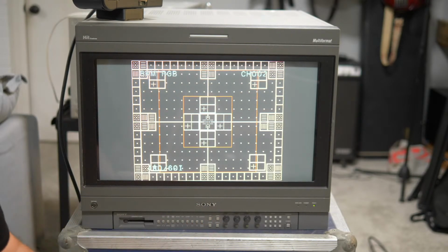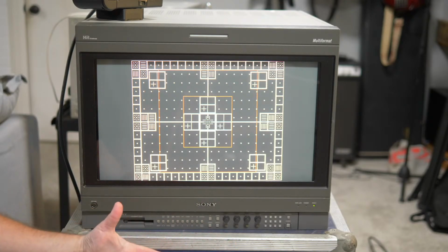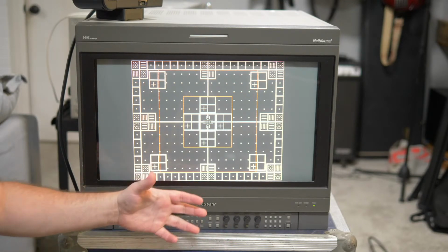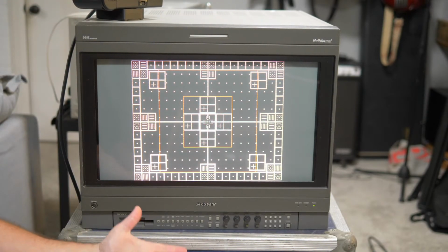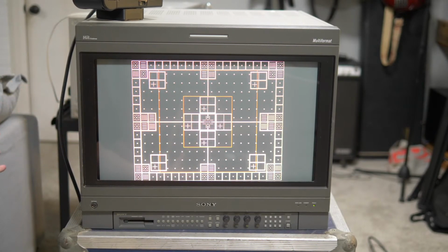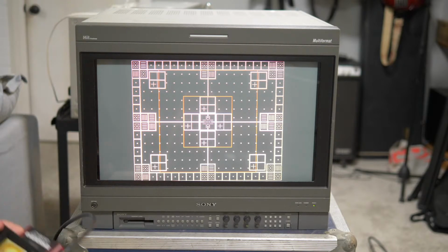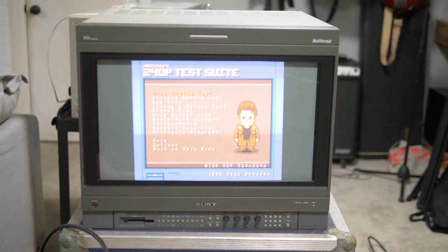So let's just say hypothetically that the monitor was in bad condition. It's not, it's in great condition, but let's just say hypothetically it was in bad condition and the capacitors are the reason that that shifted up. So when I replace the capacitors, I just have to shift it down 3 notches. Totally fine in my book, not worried about that. Let's also check some scrolling, and I'll jump back in the chat in a few moments, but just give me a moment here. Keep the questions coming, but, you know, be patient if you don't mind.